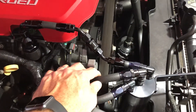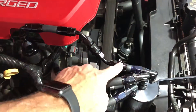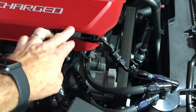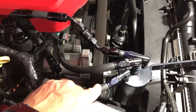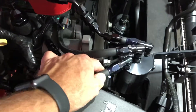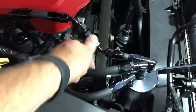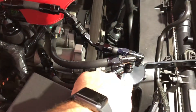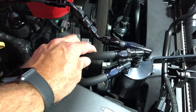So I went ahead and utilized the check valve, and now it can only pull one way. If the valve cover side has more vacuum, then that side will do the work to ventilate the crankcase. If the other side has more vacuum, then air will not go through the valve cover side — air will only go the correct way. So this can only help to vacate the can; it can never bring air into it, robbing the other port of the function it needs.